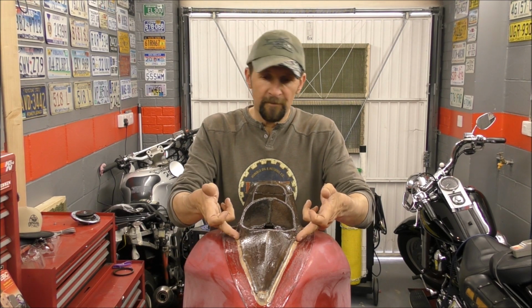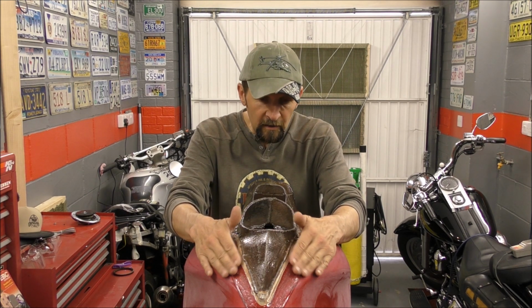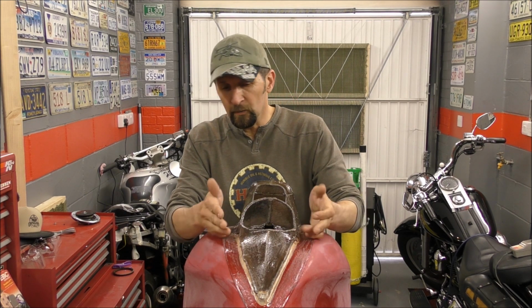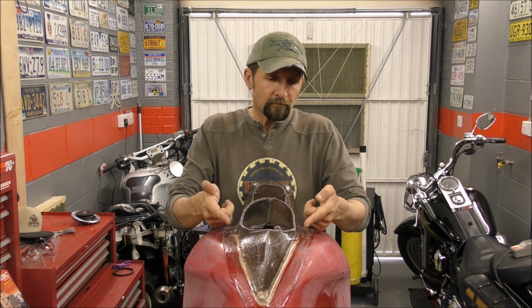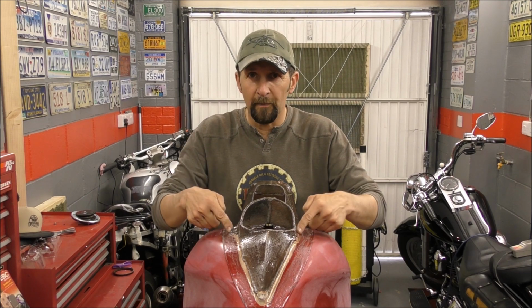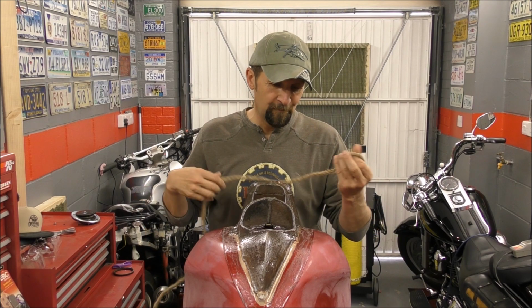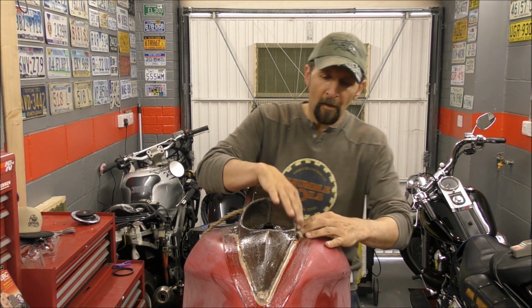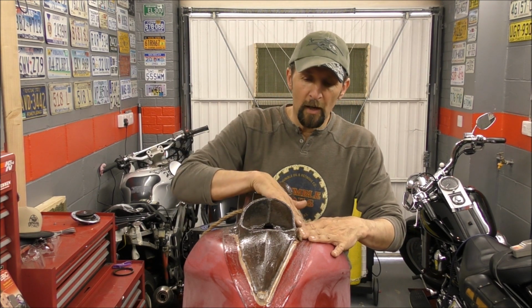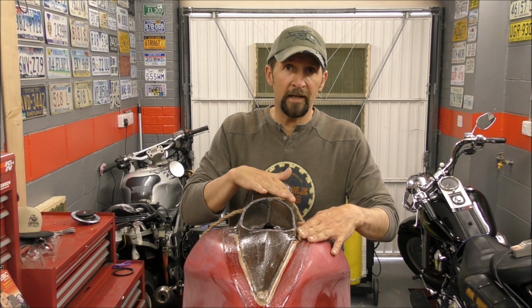What I'm going to do is, from this area here at the back of the tank is very thin. I can use filler, I can make a nice job of that. But from here, where there's a 90-degree edge there, and kind of a 45-degree edge there, I'm going to bridge out. I'm going to fill up this edge a little bit here with some hemp rope. Now that sounds a bit stupid, but it's really super lightweight. It doesn't weigh anything. I can stick that on there, bond it in, fiberglass over it, and it'll be permanent and forgotten and immortalised in there forever. And it'll be a really lightweight solution. And then I can put just a thin skin of filler over the top.